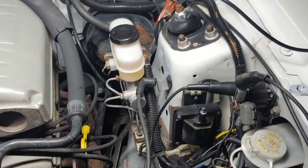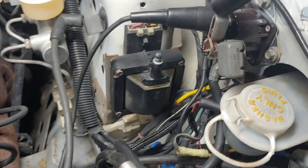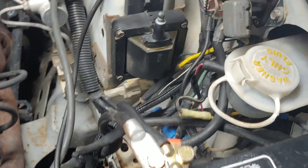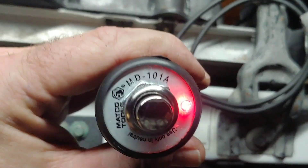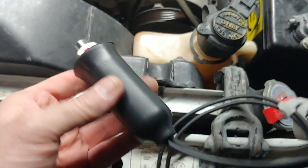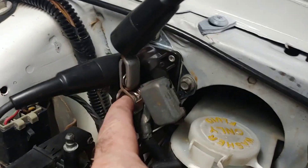That's the way to do it without a spark plug tester at all — just remove the plug wire from the coil, try to get it kind of dark, have your buddy spin the engine over a couple of times. If you don't have a buddy with you, you can use a starter bumper. I'll give you the part number on it too. I'm using this Matco starter bumper — nice unit. This is a quality thing compared to the junky parts store ones. If you want to shortcut the ignition switch and just make this thing crank over, hook this up and look up to the right side of the coil and to the little coil wire on top.